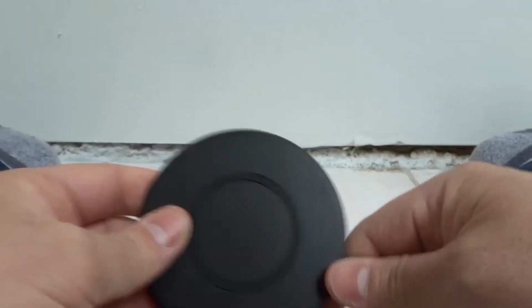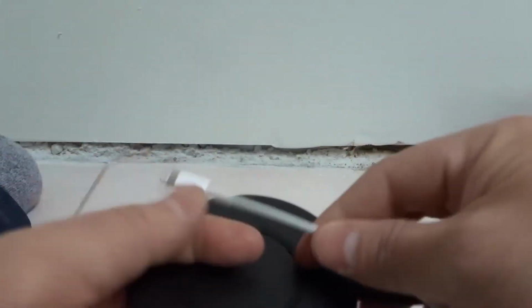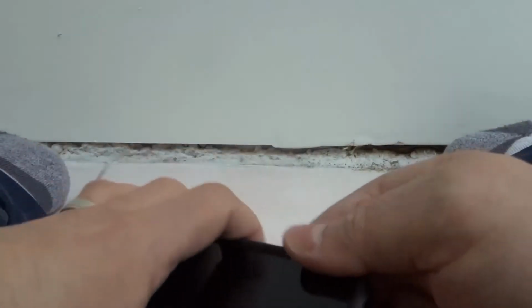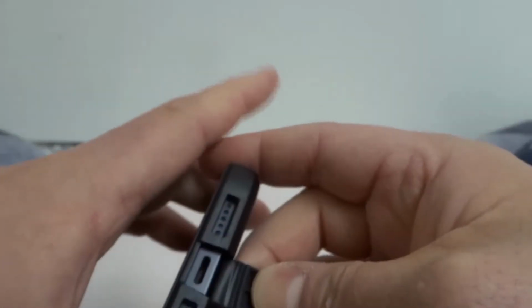If you have a wireless charger like this, place it with another device and make sure that the charger itself works. Then you can rule out that it is the charger itself. Make sure that the charger works by using it to charge another device. That's step 1, because if the charger's a problem, then you gotta replace the charger. Very simple, okay?